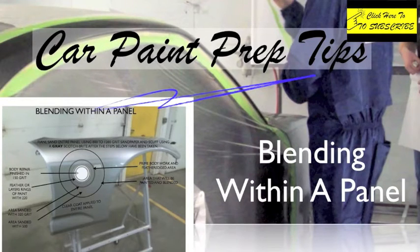Now we're going to go ahead and clear coat that whole panel though. But we don't want to sand that with the 400 to 600, or you will be able to see through the clear coat and see the scratches. Some painters I've talked to have said they put the clear coat over 600 grit scratches and don't have any problems. I don't recommend that. I've never done that, but I'd prefer doing it anywhere between 800 and 1200 grit. I usually use 800 grit. The clears I use cover those scratches fine, and you never see those scratches. So the entire panel I'm going to final sand with 800 grit sandpaper.